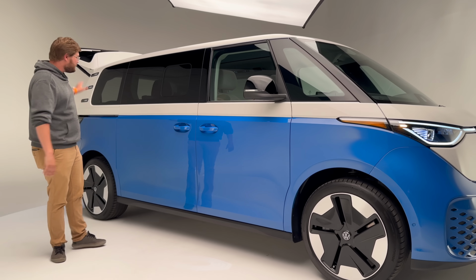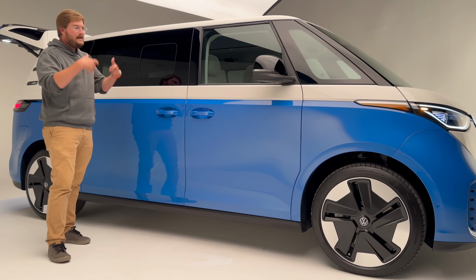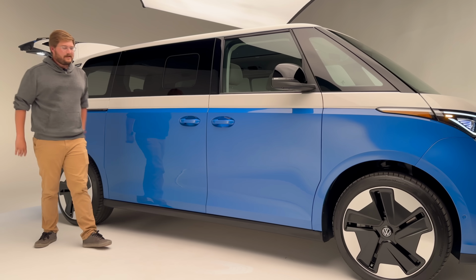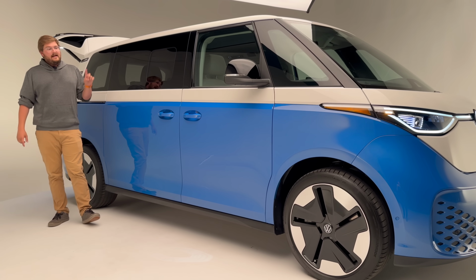And the all-wheel drive version will be very similar to like ID4. It's slightly different motors, but you'll have a permanent magnet rear that's always engaged, and then an induction front motor that's there just to supplement power. So you have very little parasitic loss or residual loss by having an induction motor up front. Basically no flux-related losses, and that's why it's only about 8-mile difference they're expecting in the drive cycles.